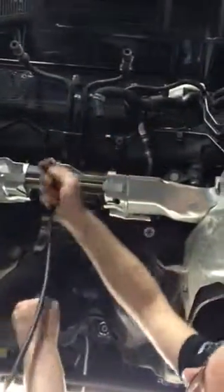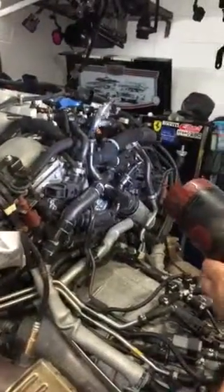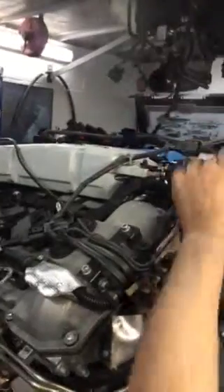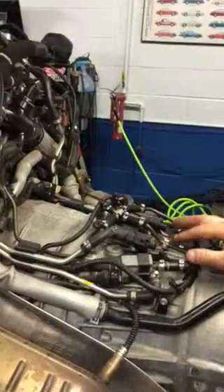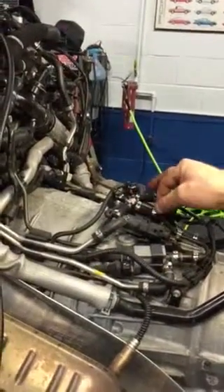Now I'm going to remove that hose off the middle — as you can see the smoke right here — and connect it to the engine. In the last video it wasn't too clear, but this time I'm going to show you exactly where I'm connecting, where that vacuum cap is painted red. Smoke machine's on and connected — it's going to back-feed vacuum into the circuits and solenoids that control the turbochargers. All these lines are replaced with metal lines, the rubber cloth hose, and all the factory clamps.